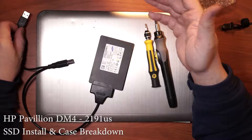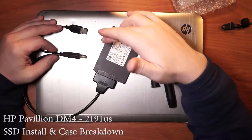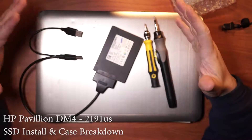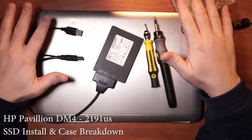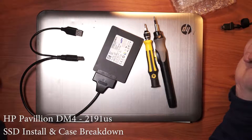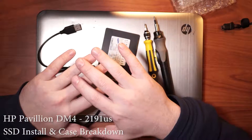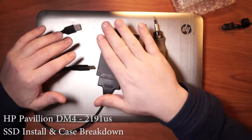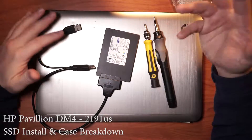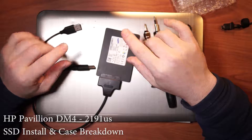You run into bigger problems when you're partitioning out a hard drive. Programs don't use the information faster because it still has to come off a single drive and single channel. So I'm going to save a huge step and just clone straight to here — that's if I don't want a fresh install and I want what I had. Sometimes it's nice to redo a computer, wipe everything clean, start fresh — because programs and files get cluttered. That's why it's nice to have a base hard drive software image, slap that on, and add your stuff without malware, bloatware, viruses, or driver issues. A fresh install is always nice, but we're going to clone. Let's get to cloning.